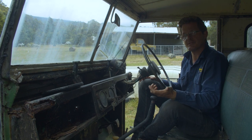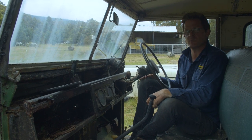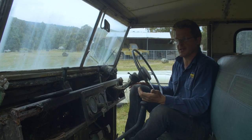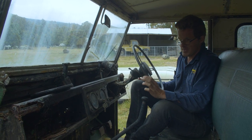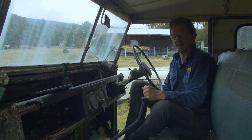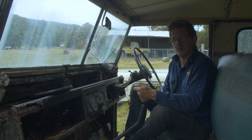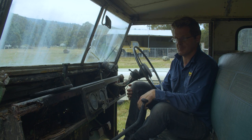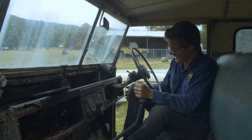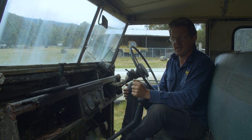One thing I haven't talked about yet is the body panels. Sadly this vehicle has a lot of cancer rust, and this is really one of the key killers, particularly in wetter environments like the UK and here in Tasmania. Getting a vehicle with minimal rust is the best place to start — take a long flat-bladed screwdriver and, if the owner isn't too precious about it, have a little poke around. The footwell each side looks nearly as good as when it came out of the factory, but I can tell it's got more fibreglass than a Rip Curl surfboard, and that's not a good thing.